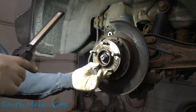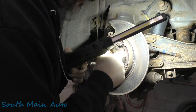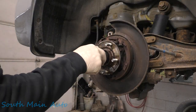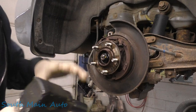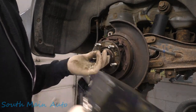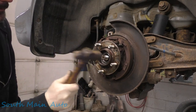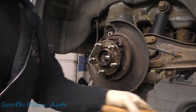The only big deal will be getting it off — we don't have much to press against as far as using our last-chance, first-try hub pusher. Maybe we can knock a stud out and catch just the edge of it to crack it loose. Let's grab a 30-something — looks like maybe a 32. Oh yeah, first try! 32 it is. Hoping the axle just pushed in but it didn't, so we'll give it a couple light taps. Yes ma'am — that pushes in nice and easy.